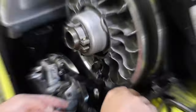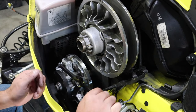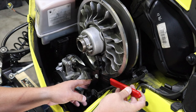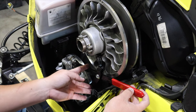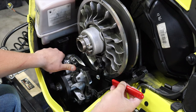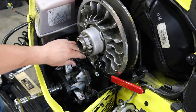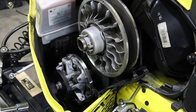It's a really handy tool. I use it on a lot of things, but this keeps the clutch from rotating as you back your nut off and use your puller tool. Now I'm putting my clutch holding tool inside of these little channels right here that are cut into the clutch. And then I'm using my tool and backing it up right here against my secondary. Just put it where you're not going to damage anything and where you've got a nice solid anchor point on your clutch.